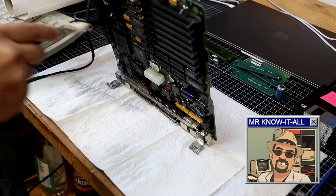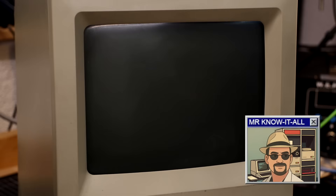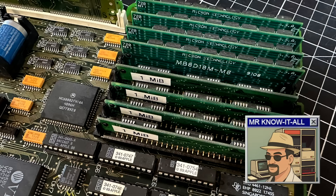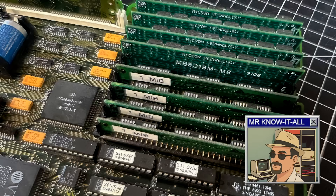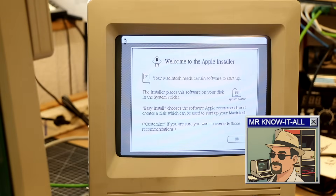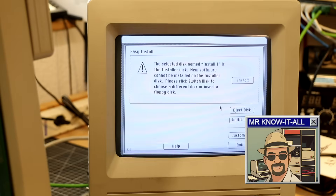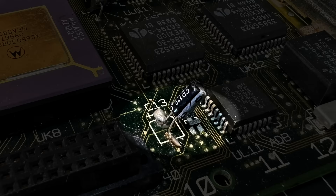After this treatment, I used compressed air to blow out the water and let the logic board dry for another day. I didn't jump to conclusions this time, and was actually checking the RAM one by one. The zebra stripes were gone and the machine started up consistently — no drama, no zebra rebellion. Checking the RAM up front would probably have been a better first step. But redoing the solder joints and cleaning the logic board wasn't all wrong either.